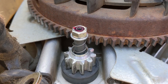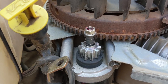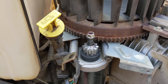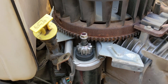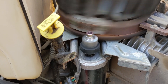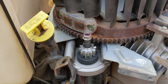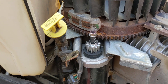I have the nut tightened down onto the starter shaft with the red thread locker on there. You are supposed to let the red thread locker cure for 24 hours; however, I should be able to turn the key and test it and then make sure the nut is tight. The parking brake is on — I'll go ahead and turn the engine over. Works as intended. I'll make sure that nut is tight on that starter shaft with the red thread locker on there; the nut should not come off.